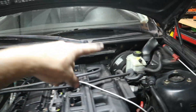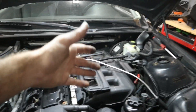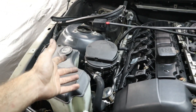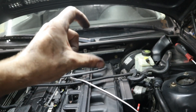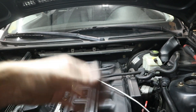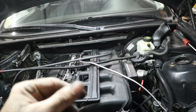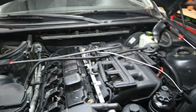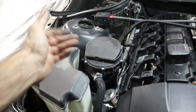But in case you've checked your vacuum lines and determined they're fine with no leaks and good vacuum from the motor, there are two other things that fail super commonly: number one, the motor, and number two, the solenoid. We're going to test them in the same way by applying power. When we apply 12 volts to the motor, it should make noise and spin up. When you apply power to the solenoid, it should click, meaning it's opening or closing. You could also put your mouth up to it and blow through it while it clicks to make sure it's not clogged.